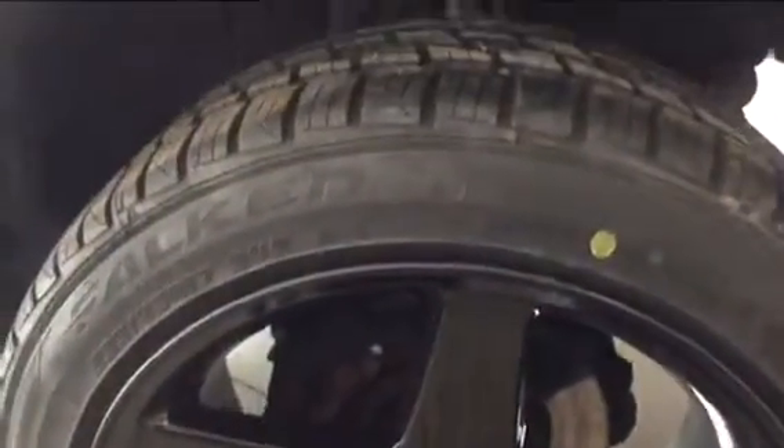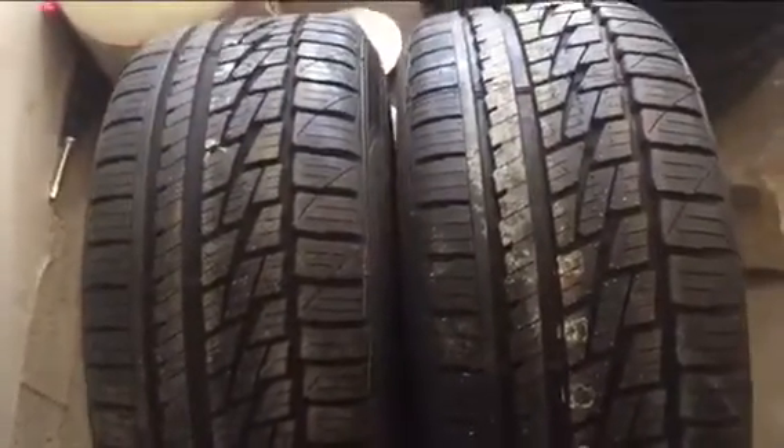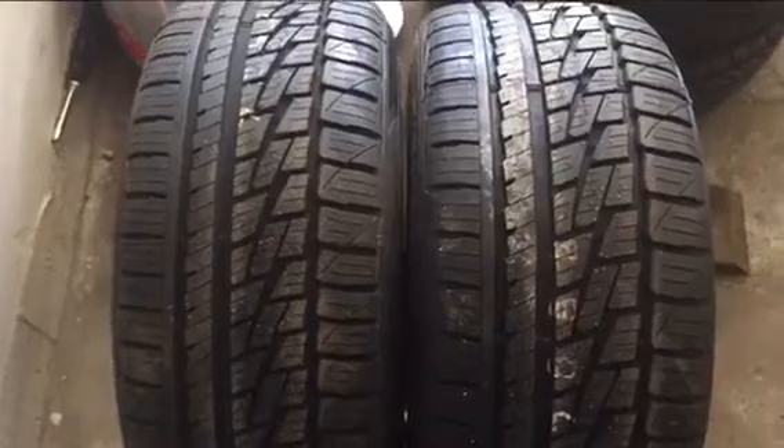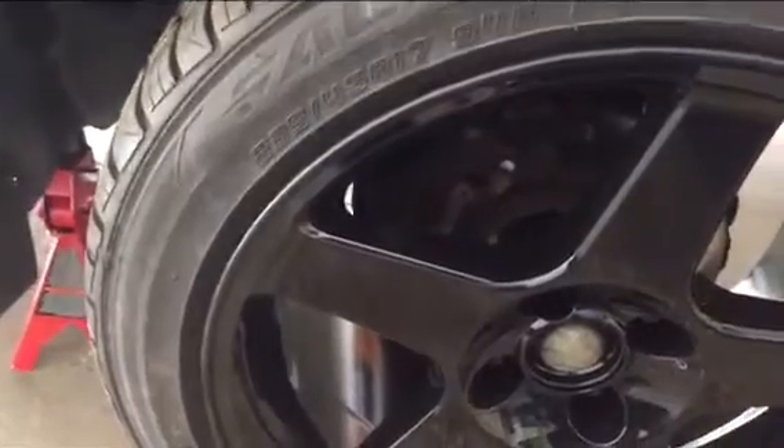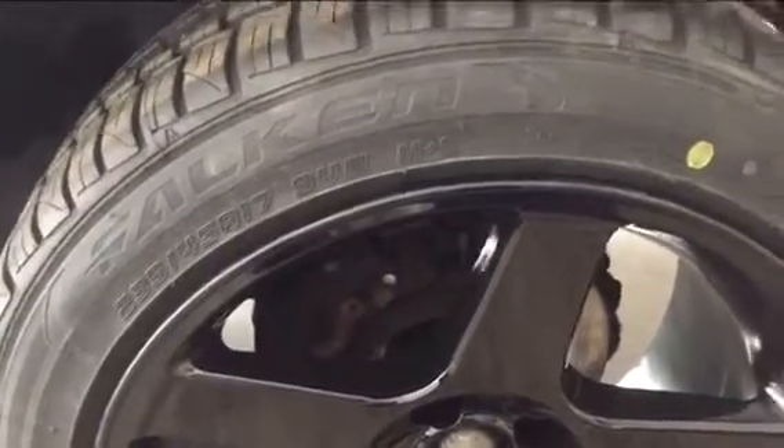That clearance could be a problem. I'm thinking that when I put weight on the tires and get the car off the axle stands, it may bring the tire up a little and give me more clearance — maybe, maybe not. On tire sizing: the back is 255s and the front is 235/45R17s. At first glance you can barely tell the difference in width, so between 235s, 255s, and 285s, you're not going to see a huge difference. You may want to go narrower — it'll mean less work.